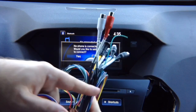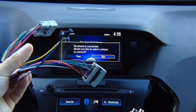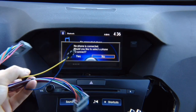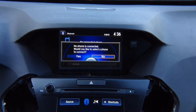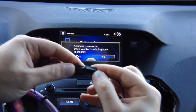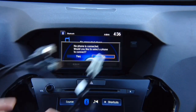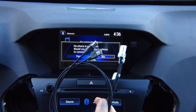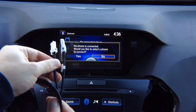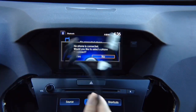Plug into the four-pin connector the optional harness for the controller — this is included to control the interface with the joystick. On the harness you have a four-pin connector — connect them together. You've also got two digital cables. You'll find matching cables — one in the back of the radio, one in the back of the screen. Unplug the factory cable, plug this one into the back of the screen. Unplug the factory one from the radio and plug this one into the back of the radio. They're identical cables.